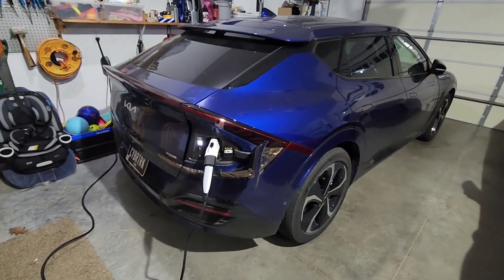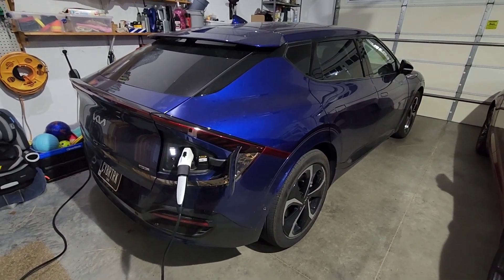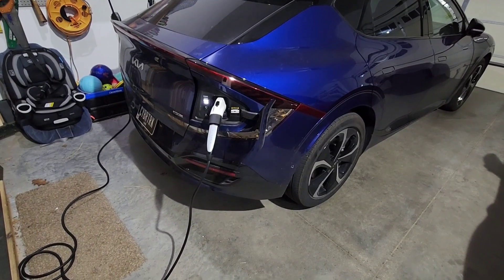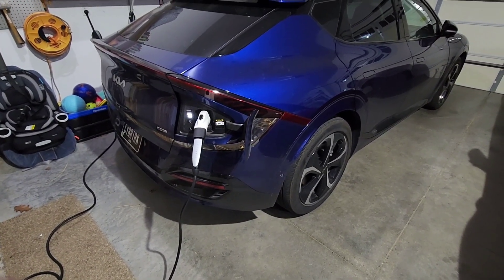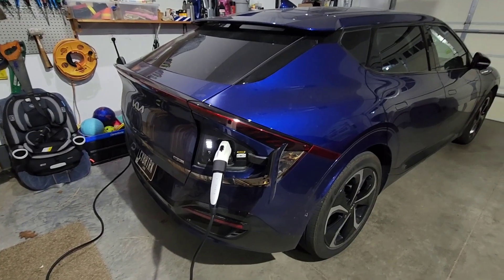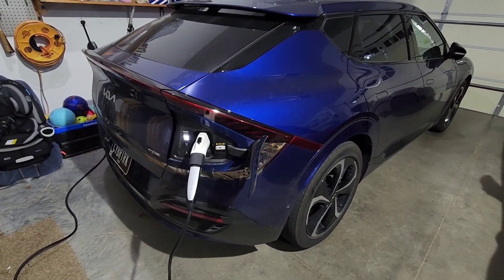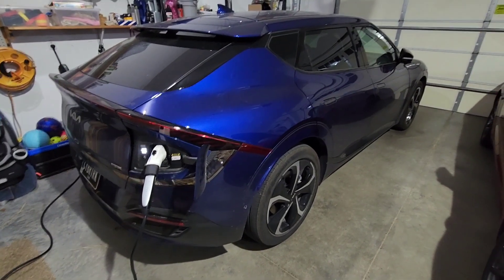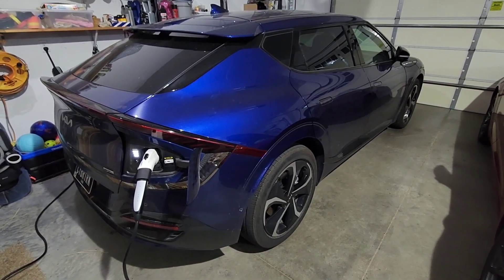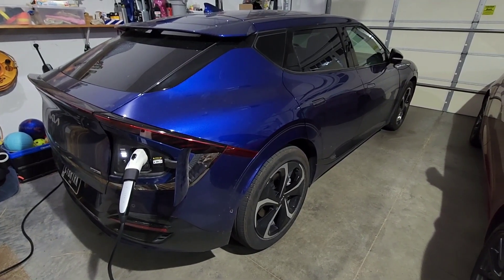I like that the Tesla EVSE is 32-amp at 240-volt or 120-volt. It's really simple to use — you don't have to get into the car and do the other workaround that other people suggest. Just use the app and send the start charging command; that seems the easiest way. Granted, this is really slow on the 120-volt outlet — it says it'll take about 15 hours to charge only 20%, so that's pretty typical. But in an emergency, or if you're parked at a hotel overnight, that might be the difference of getting to your next charger or not. Thanks for watching, and I'll have more great charging tips in future videos. If you have any suggestions, leave a comment, and please remember to like and subscribe.